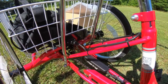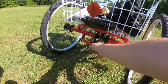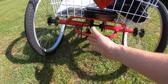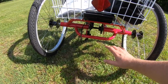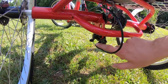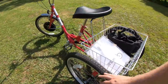The rear axle is a solid steel axle running the full width of the trike from one side to the other — one continuous piece of metal. This is a key reason the trike can achieve a high weight capacity. The rear braking is a dual-piston Pro Max 300 mechanical disc brake running off a pulley up to the handlebars, providing solid and reliable stopping power at the back end.